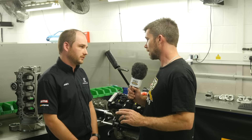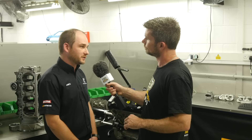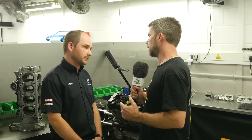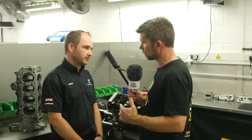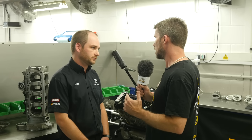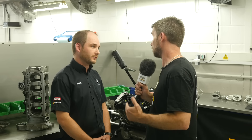If 440 horsepower isn't enough, you do have options for increasing capacity — how do you go about that and what are the capacities? We go up to a 3 litre initially with an 81mm bore and a 71.5mm stroke, and if that's not enough we go up to an 84mm bore which brings it out to 3.2 litres. When going with a stroker crankshaft you need to be mindful of the rod-to-stroke ratio — as you increase the stroke, the conrod gets shorter to maintain the same compression height and deck clearance. Being a modular bike engine, we just run a spacer plate underneath the barrel, which makes it nice and easy.